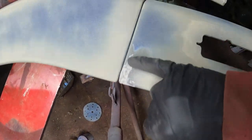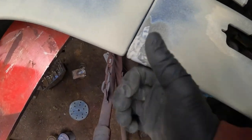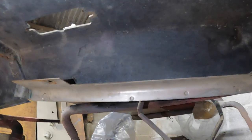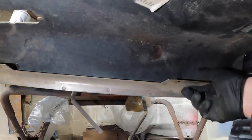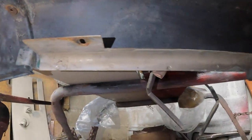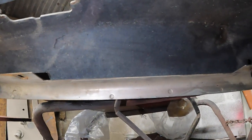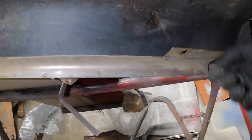We've done some repairs. We had a small crack down through here. That's been ground out and panel bond put in that. That's now really nice and tough. The other thing we needed to panel bond was underneath. There's this stainless steel bracket here that's glued, bonded, you can see it there, onto the fiberglass panel. This is where it bolts to the cab.